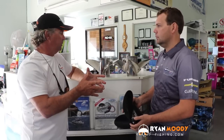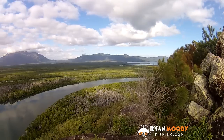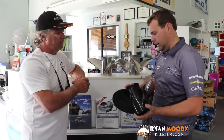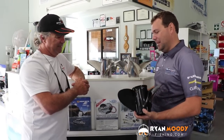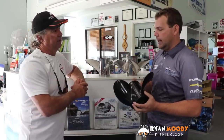When we talk about propellers you've got aluminium and you've got stainless steel. Aluminium is really good for up in creeks where there's a lot of snags, rocks, and rock bars. We see a lot of customers who hit objects all the time — hopefully most of them have got insurance, because they do a fair bit of damage. With aluminium props, most of the time if you hit something it normally takes a chunk off the blade, whereas compared to a stainless steel prop, if you hit something it won't chip the blade but it can actually damage the gears inside the gearbox — because it's got no give. The aluminium is basically the give when you hit something; it's a nice soft material, where stainless is a lot harsher.